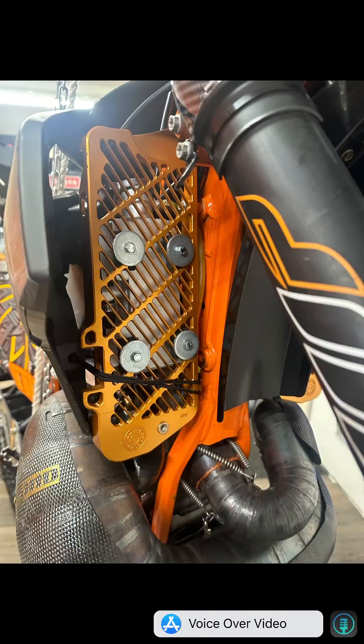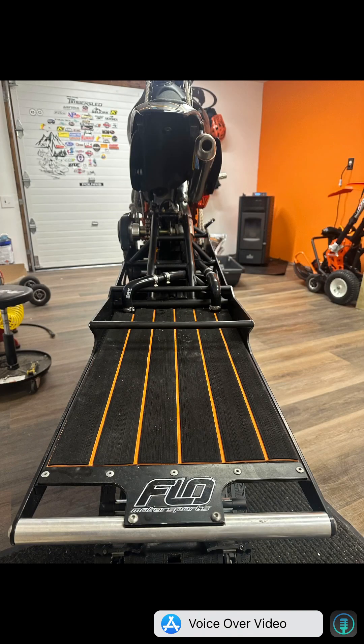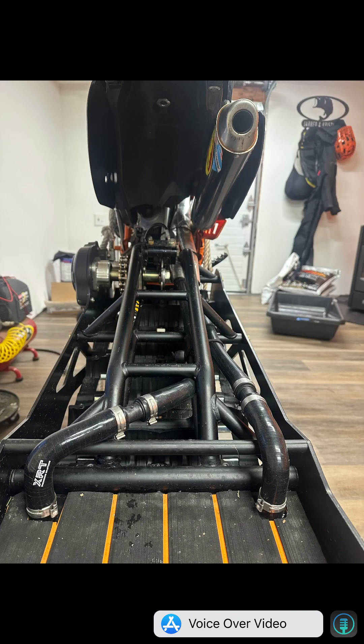When you have it finished and fully mounted to the radiator guard, I place a little bit of rubber between the radiator guard and the bottle just to help with abrasion and vibration. Here is the finished tunnel heat exchanger — you can see where I've routed the coolant hoses underneath some of the subframe to help protect the routing. I also wrapped some of the hose with a heat exhaust guard to protect it in areas where there's some excess heat.